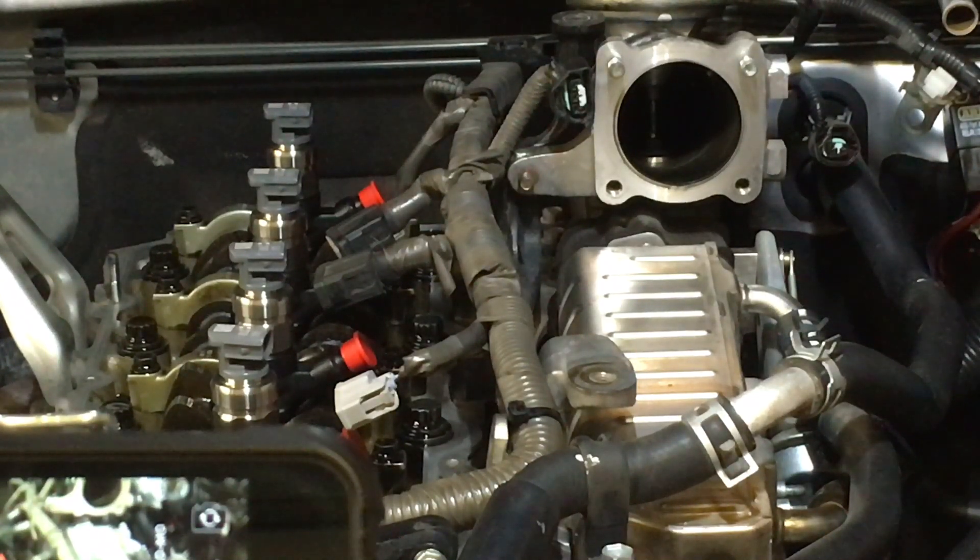Pilot Learn is another procedure that has to happen — the ECU will recognize, hang on, what's going on here? If you've changed an engine or injectors or something like that, how does it know? It doesn't know until you put the compensation codes in. When you put the compensation codes in, you've just told the ECU you've done something. So if you were to put injectors in a vehicle that doesn't need compensation codes, well then it doesn't need them — that's fine too. But if it does need them, it doesn't know until you put the compensation codes in.